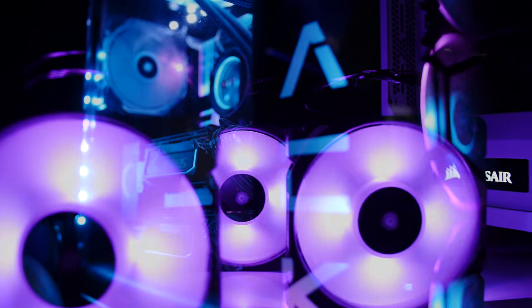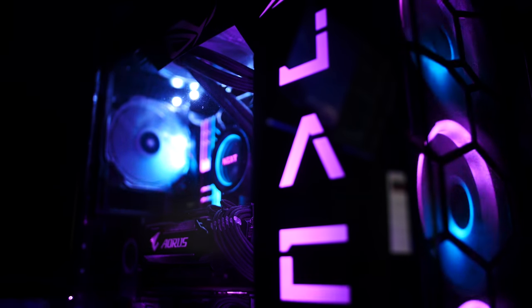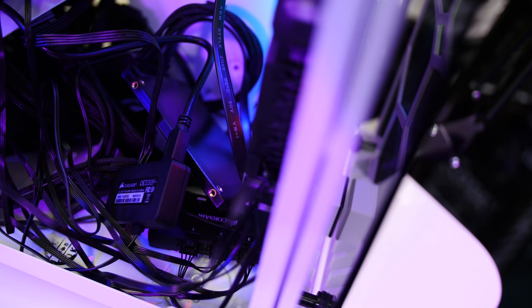I've got HD and LL fans mixed in my build, and I wouldn't be surprised if you wanted to do some mixing and matching of your own. If you decide to go that route, you'd occupy both channels on your node or commander, which doesn't leave you any left for LED strips if you wanted to stick those in as well. If you want everything, you'll very quickly end up with a rat's nest of cables unless you've got a lot of space to work with.